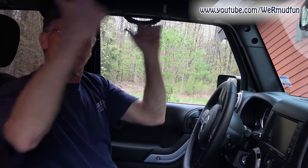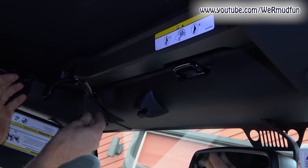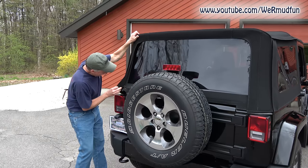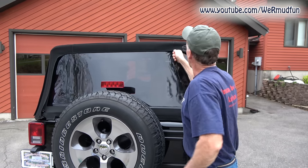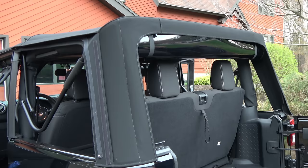Now we're going to show you how to put the whole soft top down for that convertible feel. First: sun visors come out — pull the clamp back, do not let it release; same on the passenger side. Next, head to the back. We need to take the back window out — pull down on the three bow and pull out about two to three inches to make it easier to get to the zipper. Expose the zipper and unzip. You can leave the window in and roll it — there are straps inside to hold it while rolled — but we're going to take it out.